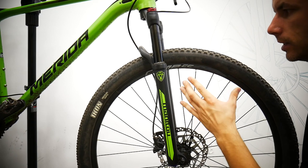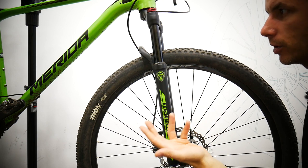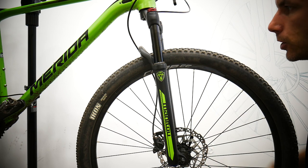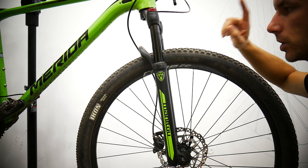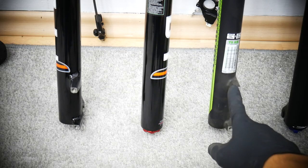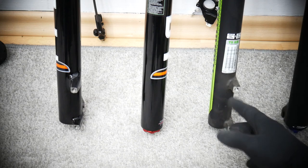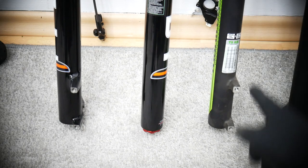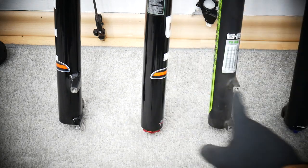And of course, what wheels you have — is it 26 inch, 700C, 29er, 27.5 plus, or 27.5? Make sure you have the right tire clearance you want, especially on road bikes where you need to make sure your tires will fit. We also need to remember about the type of brake mounting. It can be post mount for disc brakes, direct mount for caliper brakes on a road bike, or just pivots. Make sure it's compatible — you can sometimes use different adapters, just make sure those adapters are available and the systems are compatible.